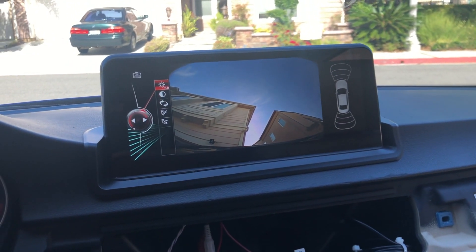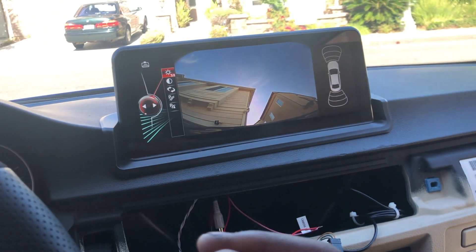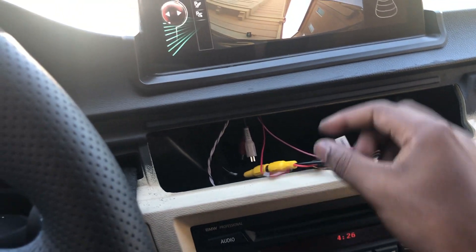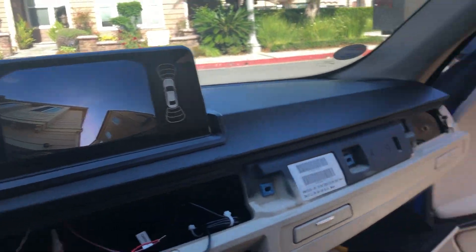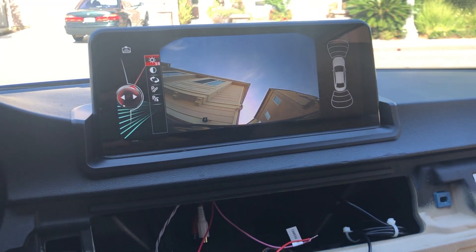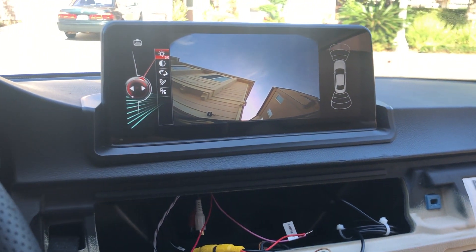Right now the car thinks it's in reverse, getting that signal from the trigger wire. The 9-volt battery is supplying the power to those wires, the power activates the trigger wire, and the trigger says okay, now I can display what I'm receiving through the RCA cable at the rear view camera. As you can see it's pointing up facing the top of my house, but yeah — now I gotta figure out how to connect those wires back there to the actual reverse bulb instead of the 9-volt battery.